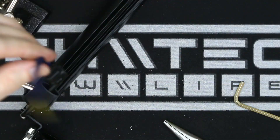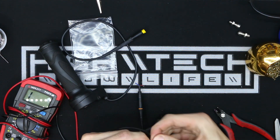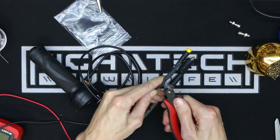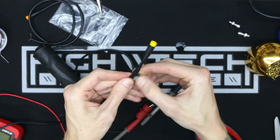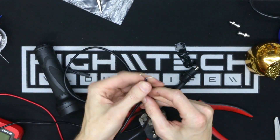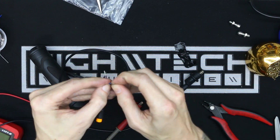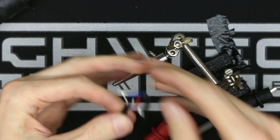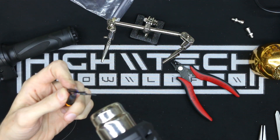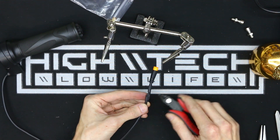You could probably make an entire connector out of hot glue — it's just incredible. I finally figured out what was going on with this throttle connector. Even though they look pretty much identical, they are actually slightly different. Even though the plug would insert as if it was working correctly, it actually wasn't making contact — which of course won't work if the pins aren't physically touching. Once I got a matching connector set, everything worked smoothly. I was only able to figure this out by connecting it up with one end's leads exposed and testing, and I realized there was no signal coming through the connector. Never underestimate the power of troubleshooting skills — they are invaluable.